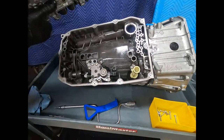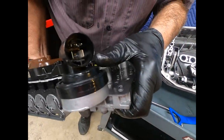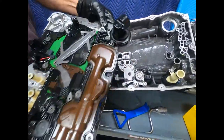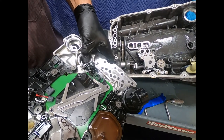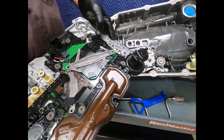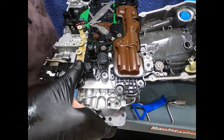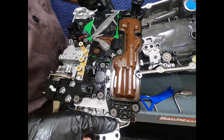Here is our electrical connector: power, ground, CAN bus high, CAN bus low, and diagnostic. Here we see the pump suction, the pump discharge, and a check valve. Remember, this is a stop-start system — the engine shuts off when sitting at a light. The engine-driven pump stops, but the electric pump starts up, has its own check valve, and supplies hydraulic working pressure for the unit.